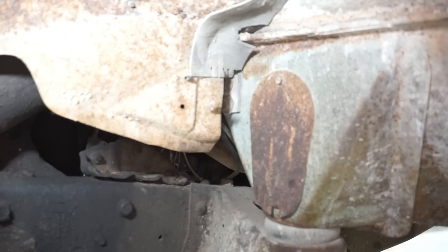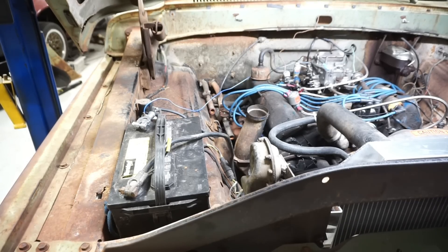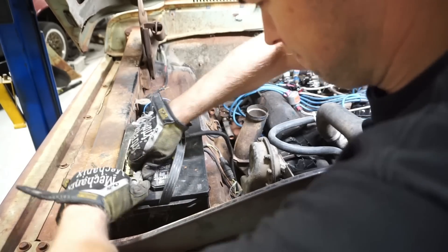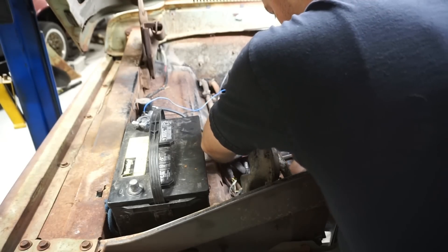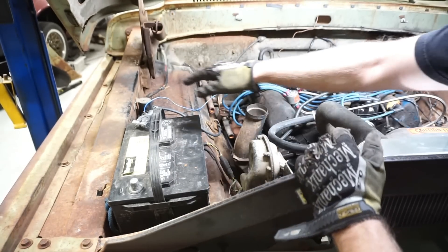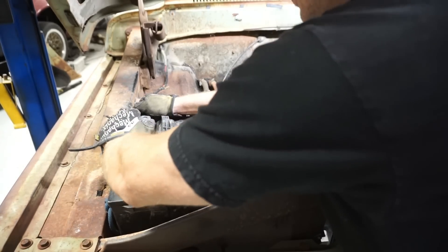The trick here to pull the top out as quickly as possible is to pull as few parts as possible. Starting with the battery side, we're just going to pull the battery cables off. The negative terminal can actually just go with the truck, so we'll leave this one with the motor. The positive side needs to just come off and it can stay with the truck as well.